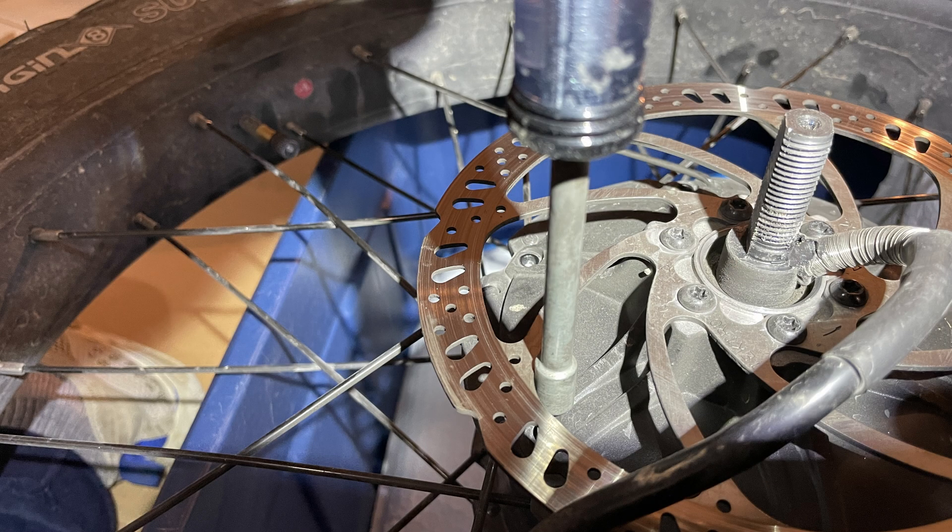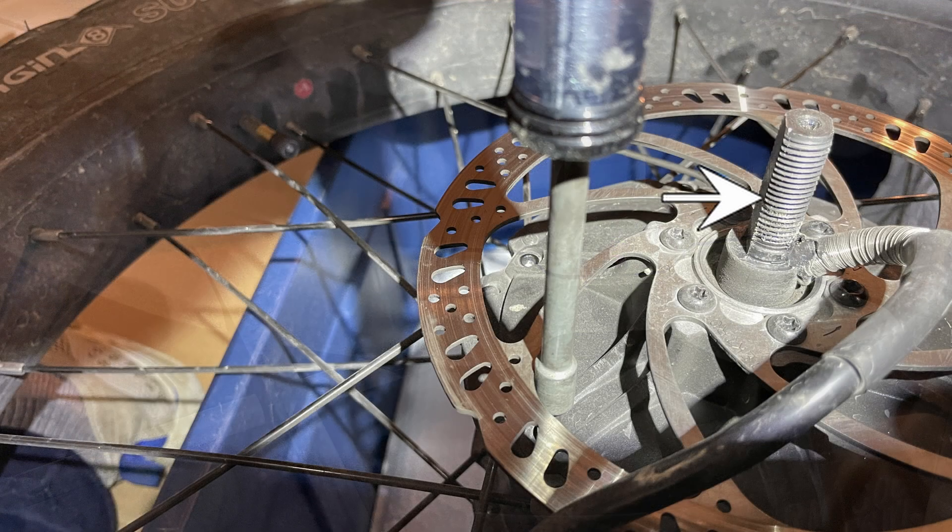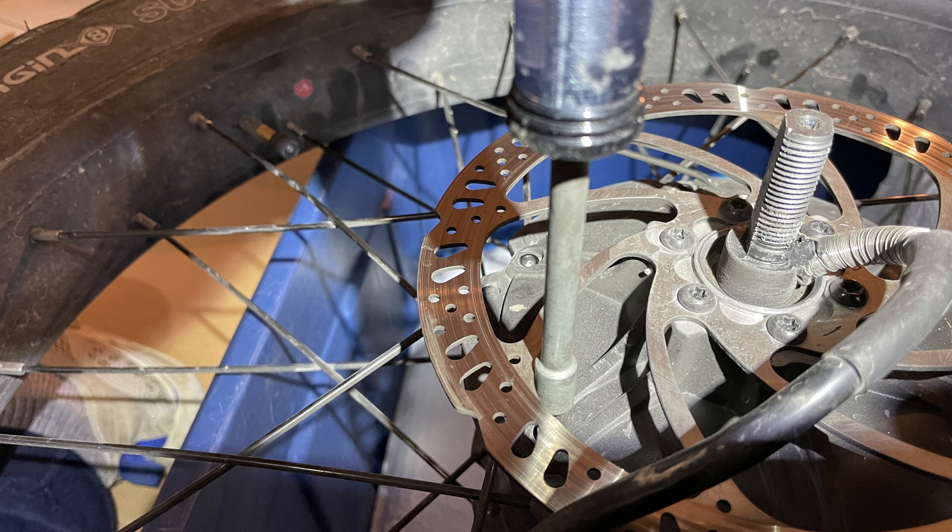The six bolts behind the brake disc will have to be removed to get off the motor cover. I made a mark on the hub and on the flange that will be removed to put them back in the same place, but I don't think that's necessary. Then I lifted the motor out of the housing by the axle, being careful to avoid the brake disc which might contaminate it or bend it. The motor didn't just freely lift out, but it did wiggle a bit. Eventually I tapped the axle on the other side just with my hand, and that was enough to let the motor come out.